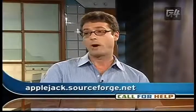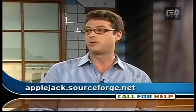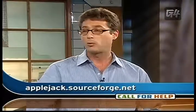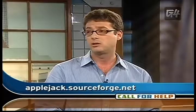Alsoft. I don't know if I have time for one more. One more, go ahead. There's a great one, again PowerPC only, although the guy's working on an Intel-based one, and it's in my show notes: Applejack. Applejack is a utility you install when your Mac is in good shape, and you can only access it if you boot up in single user mode. So you boot up your machine, hold down the Apple key and the letter S, and you get white writing on a black background. You think, what's going on here? And you type the word Applejack, and it runs these routines for you before the whole machine boots up. That's a great utility to run once in a while.